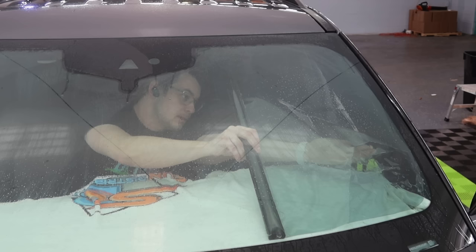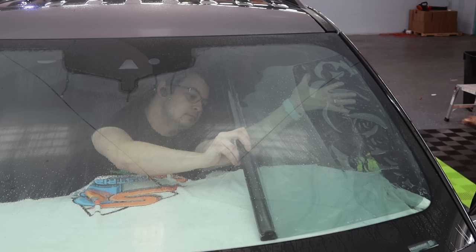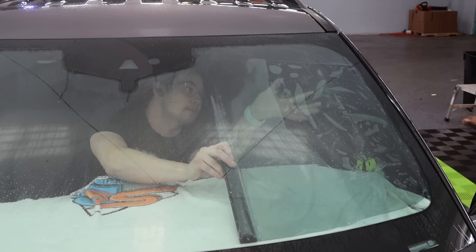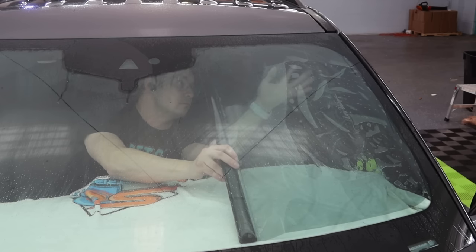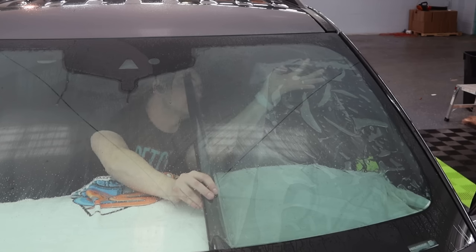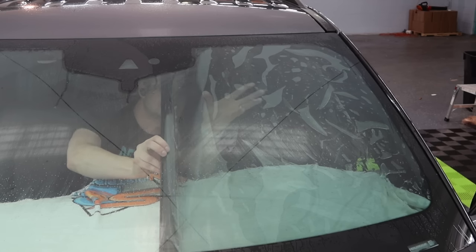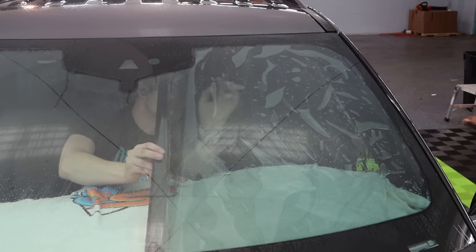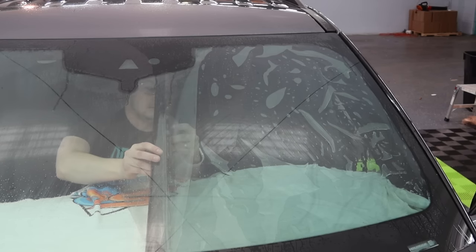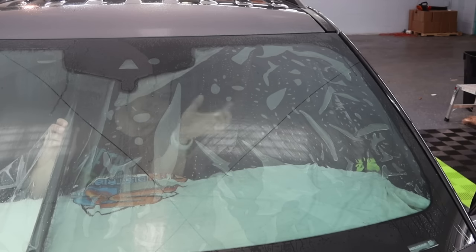I sit on the passenger side of the car and reach over to the driver's side. I used to do this opposite — sitting on the driver's side — but the film will bunch up if you're not careful, so it's actually easier this way. I got a hot tip from somebody and it's worked out really well. The goal is to try and line up as much film exactly where you need it early on. I'm only unrolling a little bit of film at a time, constantly checking all my edges, shifting it around to get my film lined up as close as possible, and then I'll pull the liner when I get about halfway because then it'll start guiding the film as I'm unrolling.